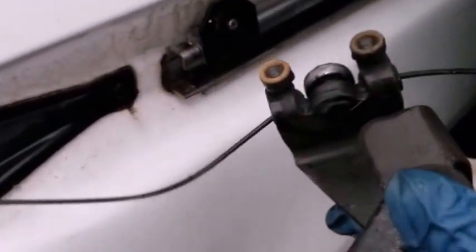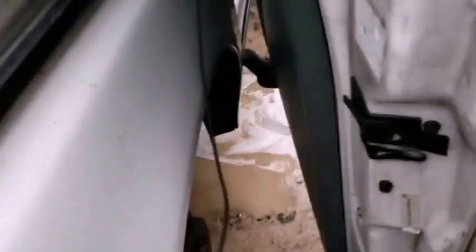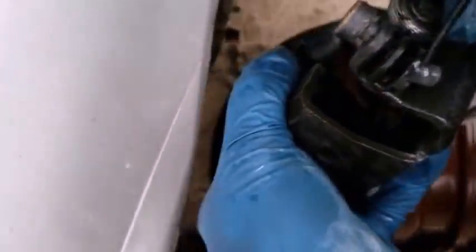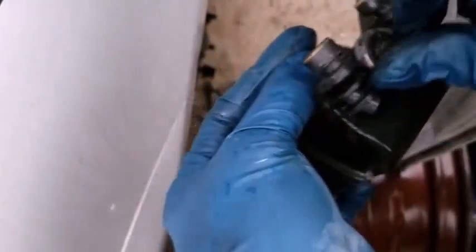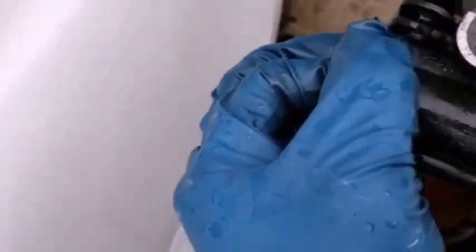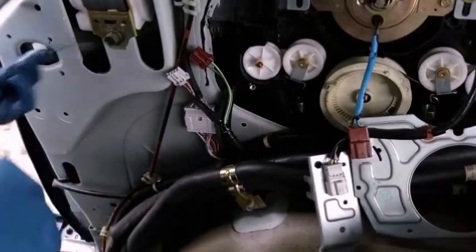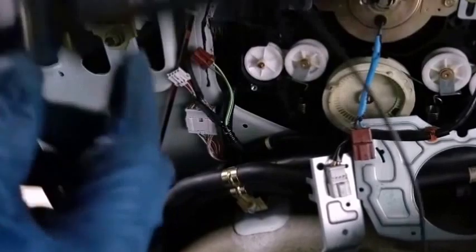There's the slot that we need. The next thing will be to disengage the cables from the roller assembly — line it up, pull down and it's out. Same with the other one: get it aligned, pull, slide down and it's out. That's the roller assembly here — set it aside. And then that's the cable now being pulled out with the housing. That's the short one which goes in front.